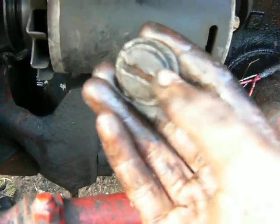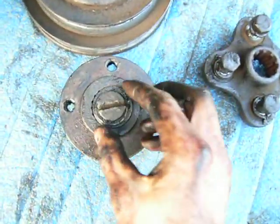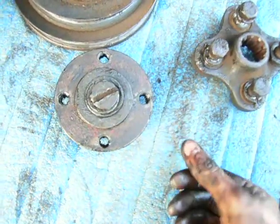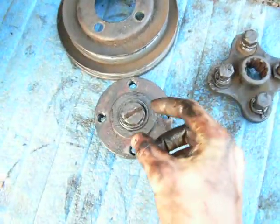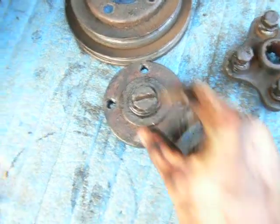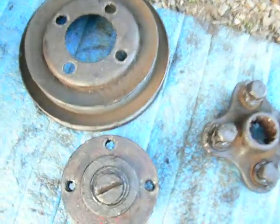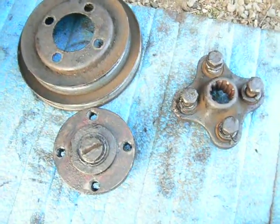So that's what I'm going to do. Maybe put a bigger washer on here, because this washer just sort of sits in there like that, and I don't particularly like that, so I'll see if I can find a heftier washer. I got it all apart and I don't see anything really damaged, so I'm going to modify this bolt, put it all back together with Loctite on these threads and anti-seize on these threads, tighten it all back up, and hopefully it shouldn't be wobbling anymore.